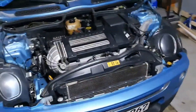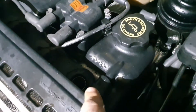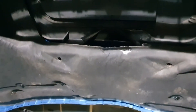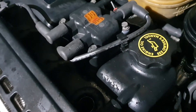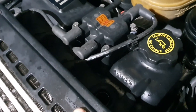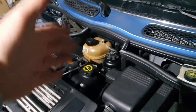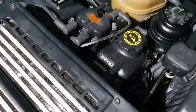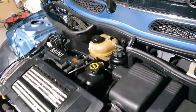I've already scanned the car and we have a misfire on cylinder 4. I took out the plug and we have oil everywhere. I'm pretty sure the engine is blown. We are going to start with a compression test, and after that maybe spark plugs and coils, but I'm not sure we'll go that far because I'm pretty sure the engine is completely kaboom.